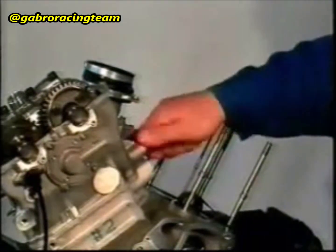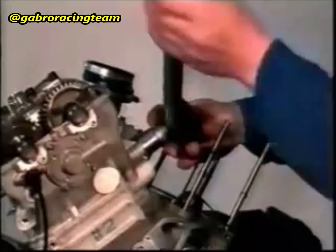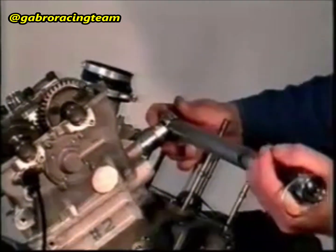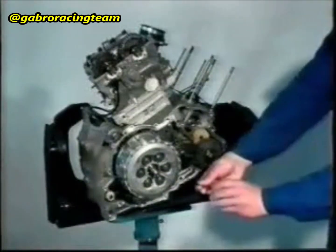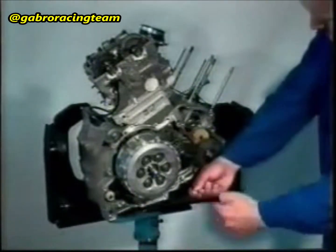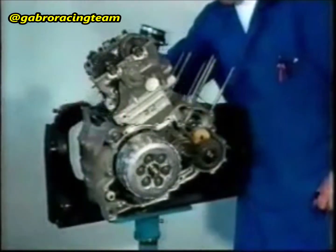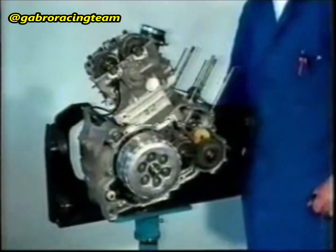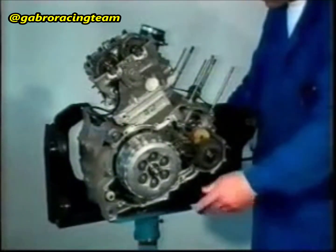Lubricate the chain tightener and insert it with a closed part into the driving direction. Screw in the M16 by 1.5 locking screw together with the relevant packing ring. The tightening torque is 30 Nm. If the locking screw is hard to tighten, release the chain tightener by pushing the ball of the oil non-return valve on the chain tightener.